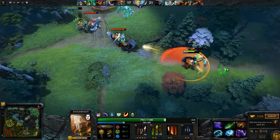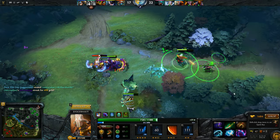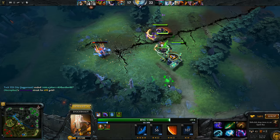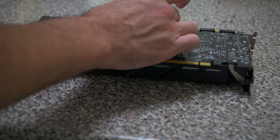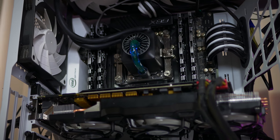Nothing to really worry about because this was only a band-aid solution until I got back here. Though on that note of modding and heat pipes, the only time you really have to worry is if your card is thermal tripping. If this happens, you have to double check everything to make sure your cooler is working properly. For example, the fans are working, the case is not suffocated, and the cooler is making proper contact with the graphics card or CPU, as that is what can cause permanent damage to your gear.